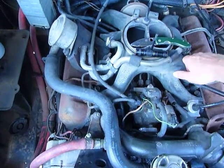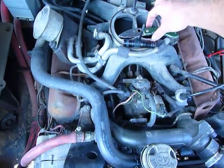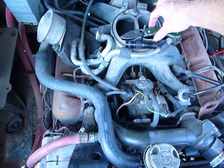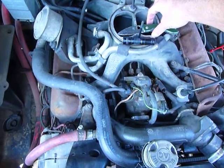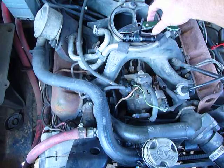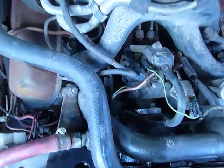How to change the timing on your injection pump of a 6.2 liter diesel. The advantages of advancing it would be more power and easier to start. The advantages of retarding it — from what I've heard — are your motor lasts longer, though I can't prove that and haven't found substantial evidence for it. Some reliable sources who do retard it are the United States military, so there you have it.